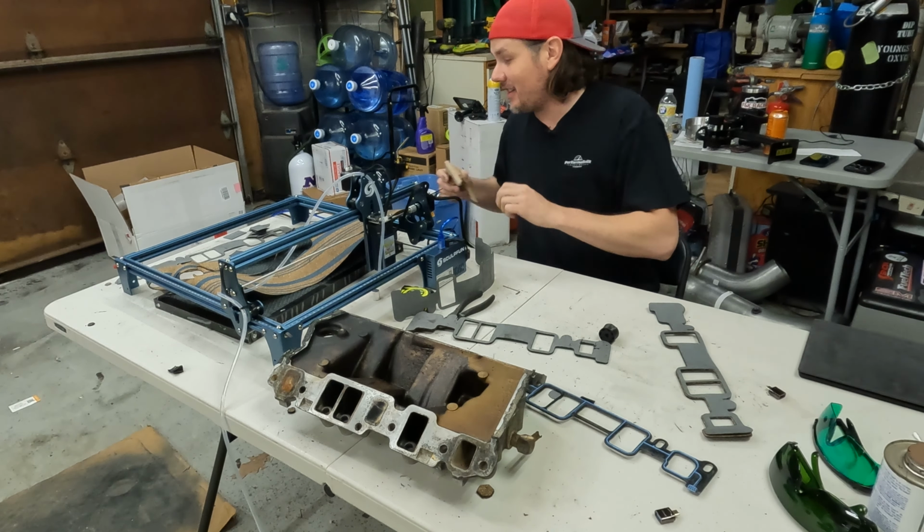I've got it pulled up here, and I'm going to open up my recent projects, where you can see I have both gaskets, the driver and passenger side, on here. And then over here I have my pass counts, where in this case I was at 4 passes at 100% power at 1.5 millimeters per second. So very slow. The thing moved very slowly and took a long time, but that seemed to be what worked after making so many cuts on cork and things like that, finding out what settings worked for the fiber gaskets. That's what I finally settled on.